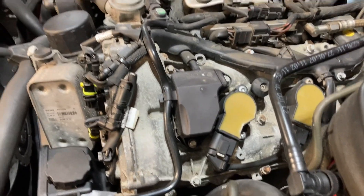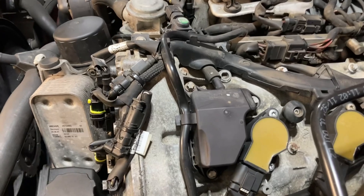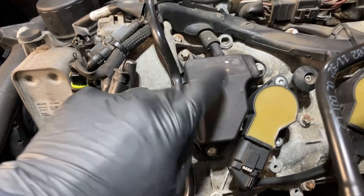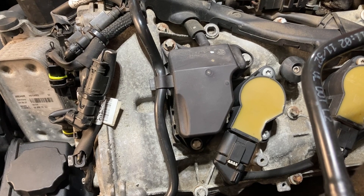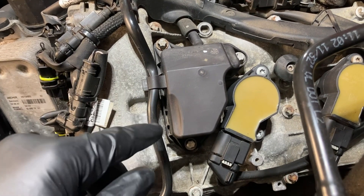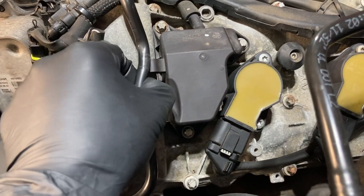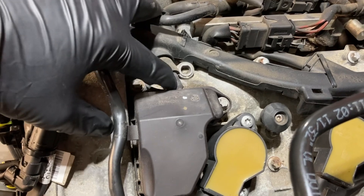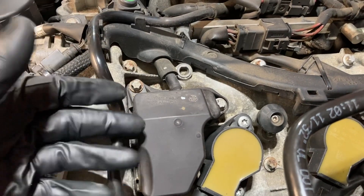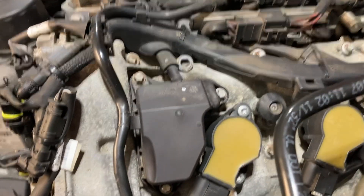A quick aside while doing the oil filter housing gaskets — going to replace the low load PCV breather as they call it. Holding this in is three E10s: one, two, three. And then this line is clamped to it. This is the line that, once the crankcase pressure is vented out, gets circulated back to the intake elbow.